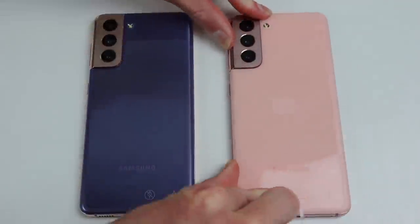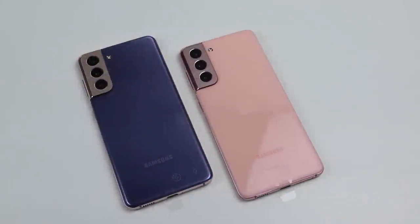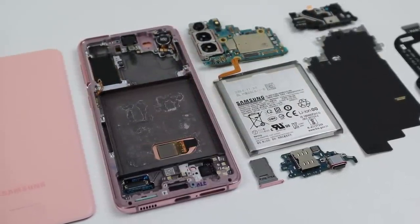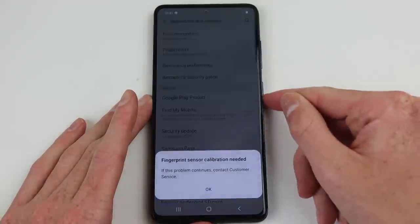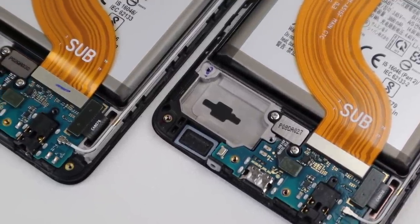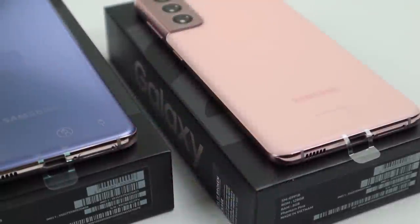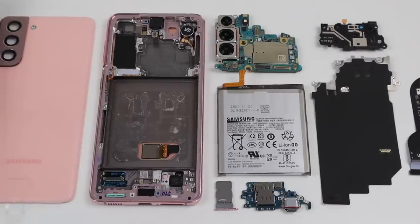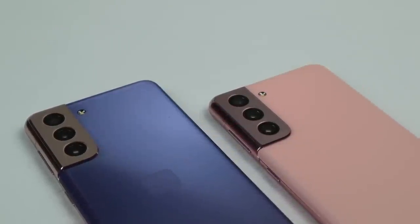After lining both panels up and pressing them down into place, we're done. Samsung's new Galaxy S21 is a phone that's more durable than the previous model thanks to its plastic back. Every major component is modular and not paired to the device, making it repairable. The battery still uses too much glue, but with some persistence it can be removed. The fingerprint is fused into the screen and isn't a modular component, so we don't see the calibration issue found in the A51. If you like what you saw, hit that subscribe button and check out the teardown and repair assessment playlist for more videos like this one. Check out my website for tips and tools — link is in the description.